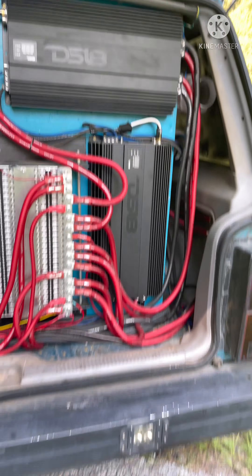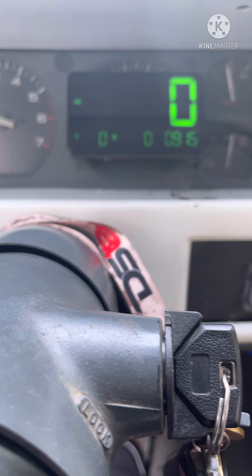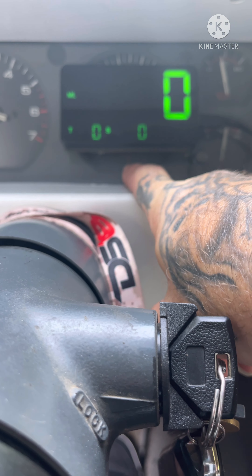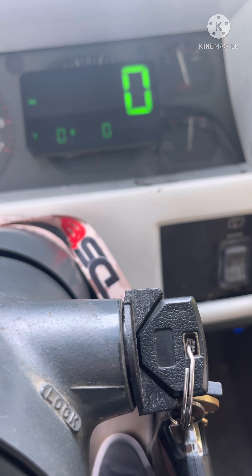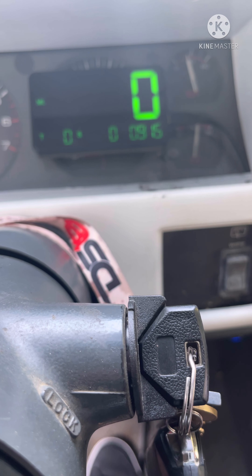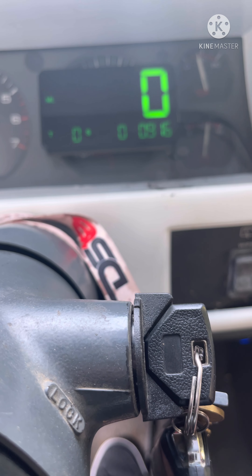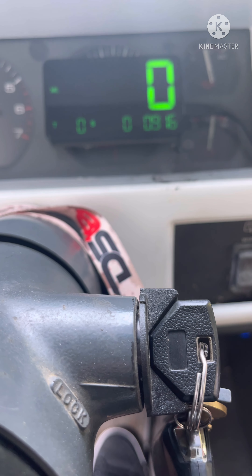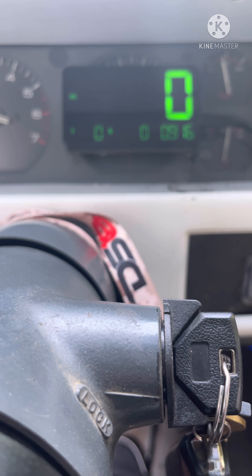One more thing — see that black box? That's my speedometer. The bass literally broke my factory speedometer so it was only reading 35 miles per hour no matter what — at a red light, doing 70, it always said 35. Sometimes the needle would just hang at the bottom. I found this on Amazon — just searched 'GPS speedometer,' plugged in a USB cable, took apart one of those cheap cigarette lighter adapters, put a hot and ground wire on it, wired it to ignition and my dash wiring. The only issue is it sometimes takes about a minute to connect to the satellite, but once it connects it's fine. And if you're running bigger tires without regearing, it can help with that too.